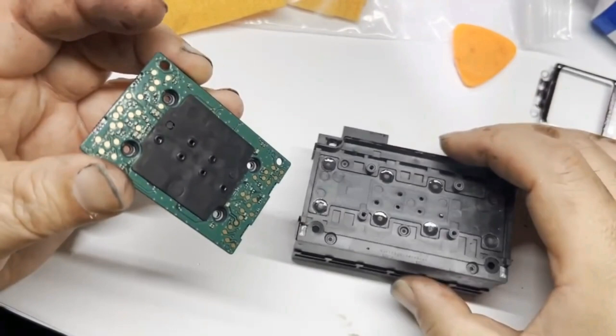If you find it really hard, you probably bought a refurbished printhead, which Epson superglued the core to the cover. There's no way you can convert it to a nipple. One telltale sign is your screws will be black instead of silver. I have a video for that — you can click above and check it out.